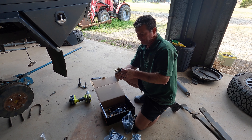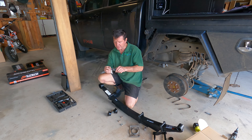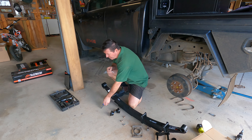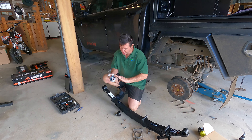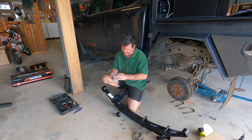Let's pop her in. We all know instructions are for losers, but in this particular kit it says make sure you use the grease that's supplied. If you use any wheel bearing grease or rubber grease you may end up with squeaks, rattles, and premature wear as well. Also make sure that everything's free of any dust and dirt when these go in — you want to make them as clean as possible.